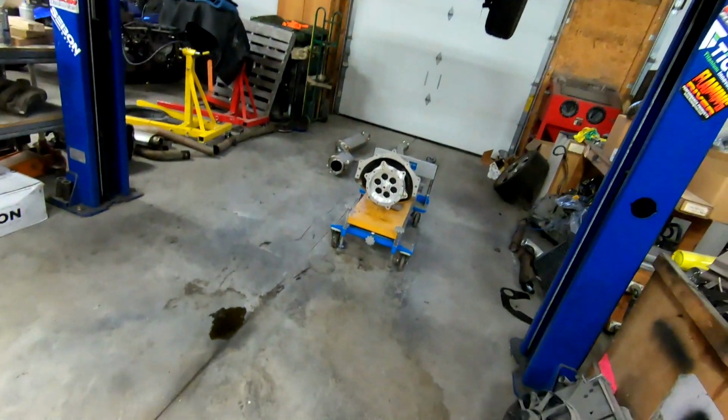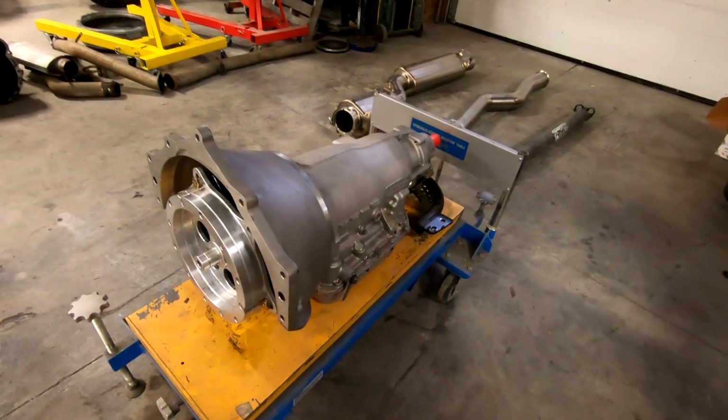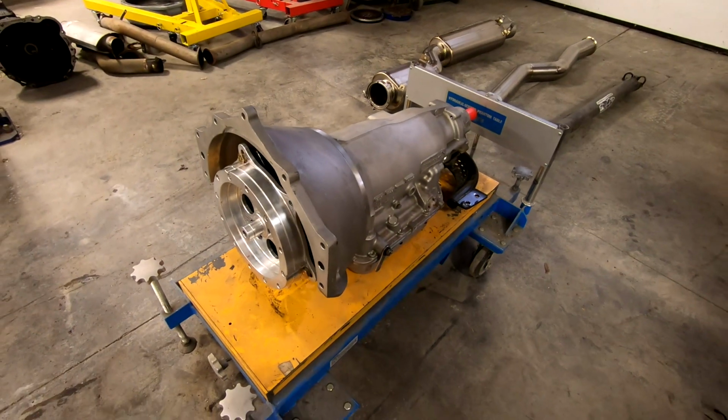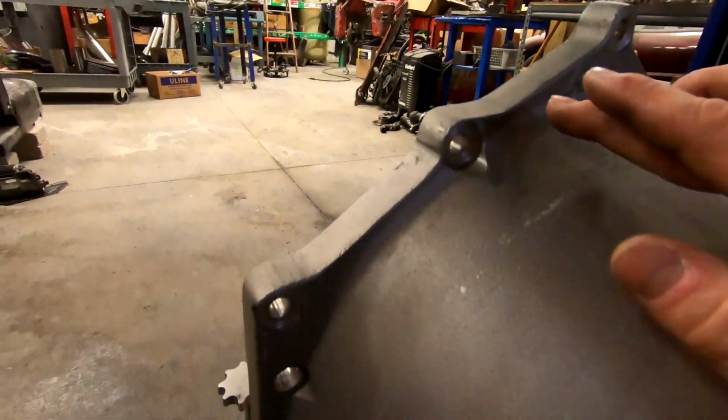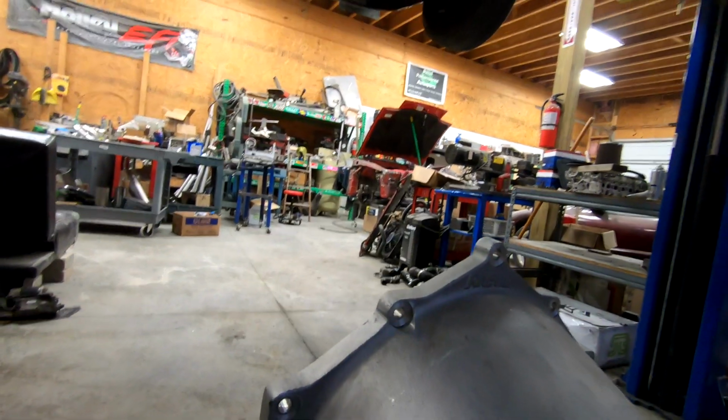Beyond that, we'll need to pull the transmission pan off of the transmission again so it can be properly sealed up. So I'm not sure exactly how I want to go about doing this. Maybe just roll the transmission over on its lid here on the top side, and then maybe I can do that a little bit more easily without creating a giant mess. And I also want to come in here and cut this upper ear of the transmission case, or the bell housing, off, as that will give me a little bit more clearance for the lines and everything else that run along the backside of the engine. So let me take a break for a couple of minutes, come back, start working on the transmission stuff, and hopefully before too long we'll have those two projects knocked out and we can get the transmission squared away in the not too distant future.